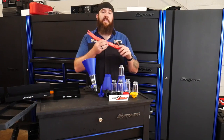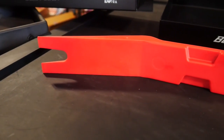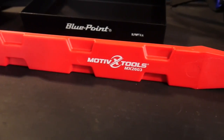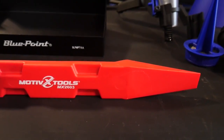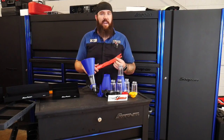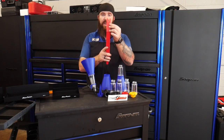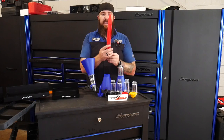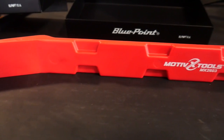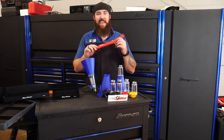Second up on the list, we also have another tool by Motivex — the Motivex Large Trim Tool MX2603. This is the large panel and pry tool that is non-marring. It's a plastic polymer, pretty rigid, but not one of those really hard metal pry tools. It comes with about a 30-degree angle on one end with a V-clip to get around those Christmas tree clips, as well as a standard straight flat pry end on the other side. I've used it twice on Chevy conversion vans that have those Christmas trees way in there, and this thing works fantastic.